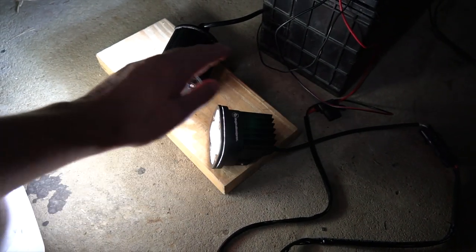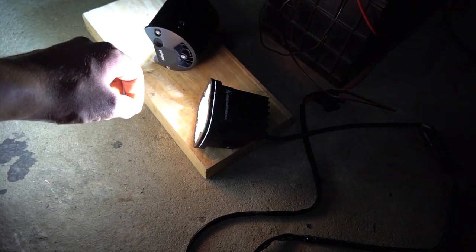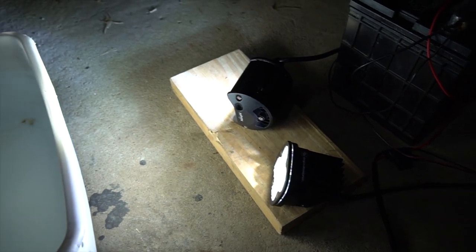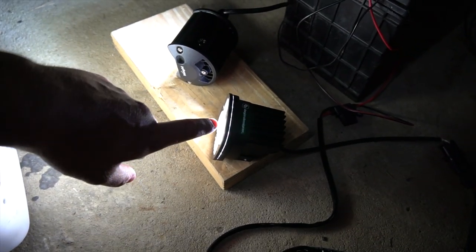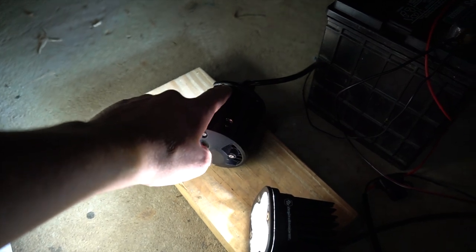I've had both lights running for about an hour now. The Baja light is definitely a lot hotter — it actually hurts to touch. It could be that it runs hotter or cools more efficiently. I'm going to unplug them both and dump them into the water for about 20 seconds. When they cool, the air inside should contract, and if there isn't a decent seal it will pull moisture in. The Baja lights have a rubber gasket designed to contract and expand as needed, whereas the Nylite uses glue — you can actually see some glue coming out on the side — which doesn't expand and contract as well.